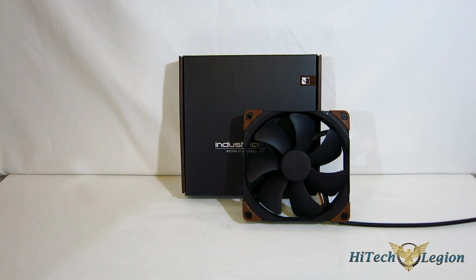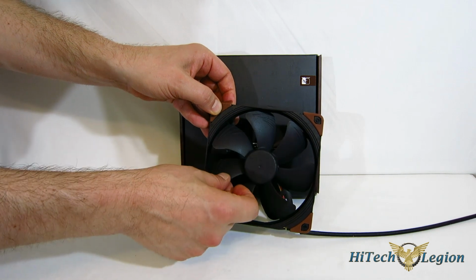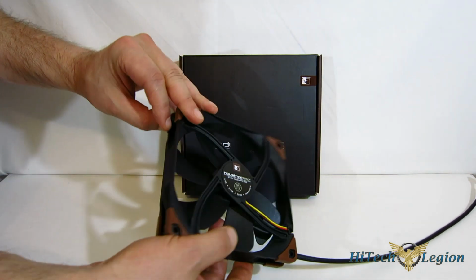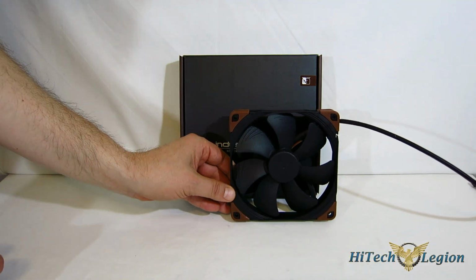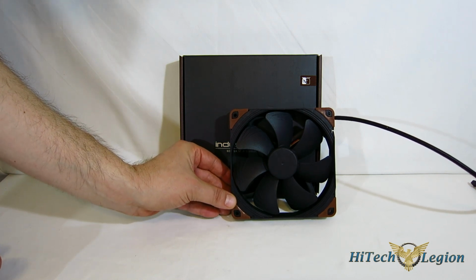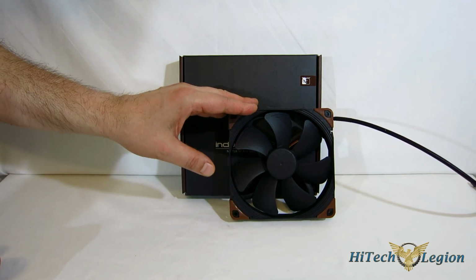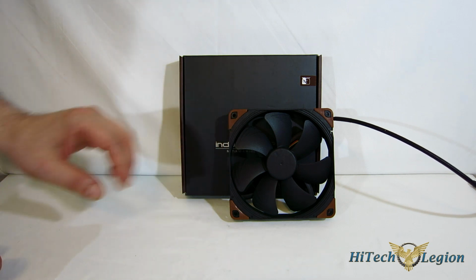Moving over to the 140s, once again, as you see, standard, very typical Noctua design, a 40140 with the notches once again in the blades, very, very nice looking. Again, available in 2000 RPM, PWM, non-PWM with IP of 52. Also available with the IP67 rating at 2000 RPM, PWM. And also available with the round basket with 120 millimeter mountings at 3000 RPM with PWM.